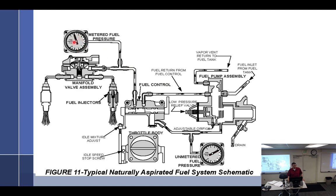Set up the low pressure first — adjust that screw. Then run it up to the high power setting, which is usually right around redline, and adjust the high-end screw. Back it down to idle and see if you screwed that up. If you did, change that one, then go back to the other one. You go back and forth, adjusting a little bit at a time until it's absolutely perfect. Then once those two are done, check idle speed and idle mixture. How do you know if idle mixture is right? RPM rise — same as always.